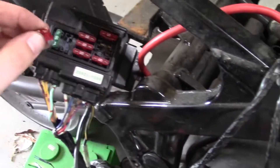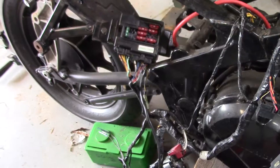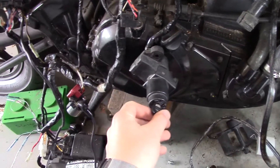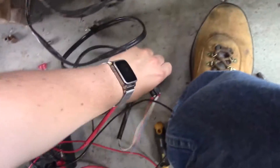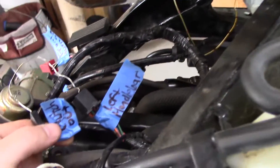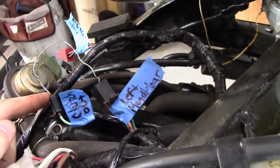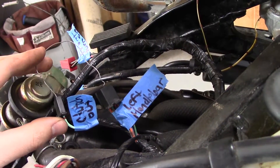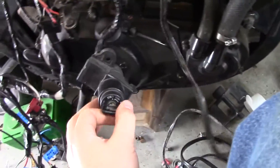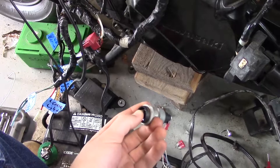I'm going to replace it with one of the spare fuses that was on the board. I'll pop that right in and see what happens now. I've replaced the fuse — let's give it some power and see if we can hear any click when we hit the switch of the solenoid. Nothing. This will crank if the clutch is out and it's in neutral, or the clutch is in and it doesn't matter. So I have connected the clutch-in switch to ground, so now it thinks the clutch is in and it should start regardless of whether or not that neutral position sensor is working. I'm going to give it some ignition, press my button, and see if the relay clicks. Nothing.